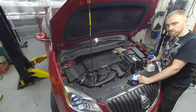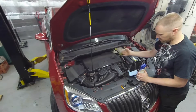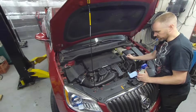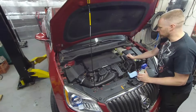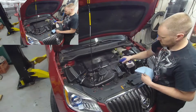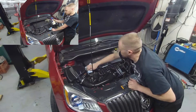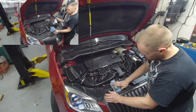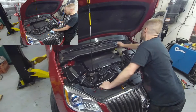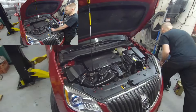For those of you who have not seen me do this yet: any big job that I do, I always try and clean up the engine bay a little bit to make it look nice, so it looks like I've been in there and done something. When they pay a pretty penny like they're doing, I like to make sure they know they paid something. Believe it or not, WD-40 is the product I use to clean the engine bay — I just douse the engine bay wherever there's black plastic specifically, and clean everything up using a rag and WD-40. The thing comes out very, very clean.